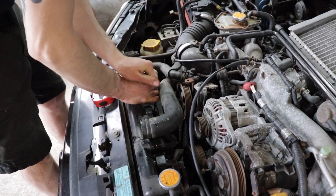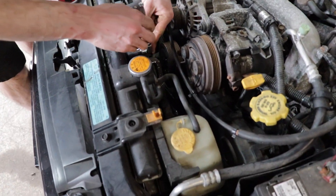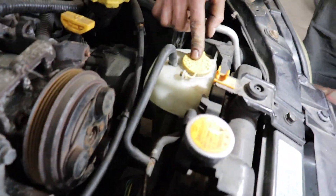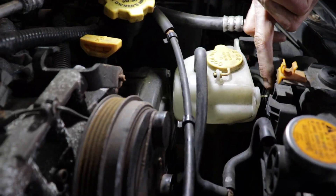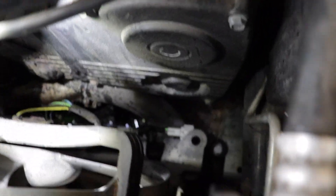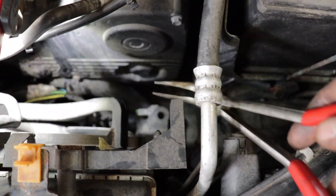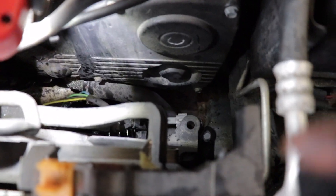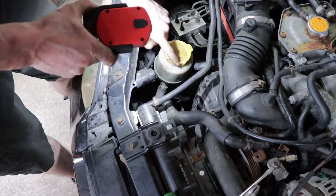If you've ever had bolts in a plastic radiator, a lot of times they don't want to come out or they break something, but today we're getting lucky. Get this washer bottle off — see this little tab right here, push this in and it comes out that way, then you pull it away. Then there's another bolt here to get the fans off. Don't forget to unplug your fans — they're down in the corner. They're a little corroded, so I had to use a 90-degree long needle nose to compress the clip and then pry it apart with a long screwdriver.